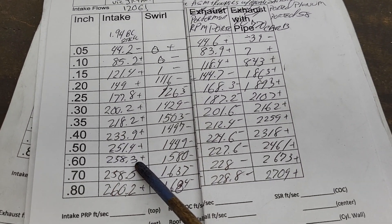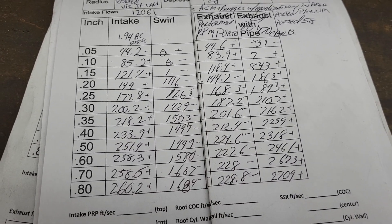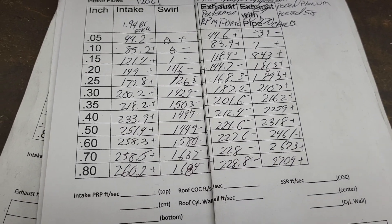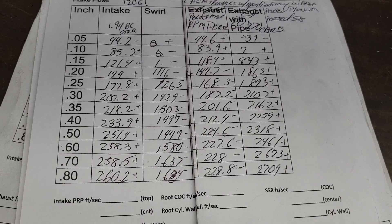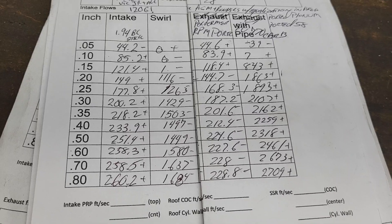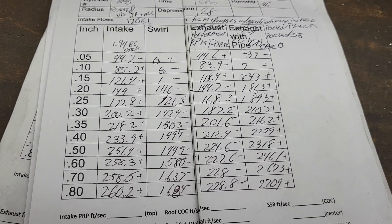From 500 to 600 lift — where this lift would be in this setup — we're at 251 to 258. Pretty damn hot. Now what if we took that head and opened it to 1206 and gave it a little more room? I would think it would go up a little bit. There's no doubt there's a restriction right there where the 1206 is necking down to a 1204.